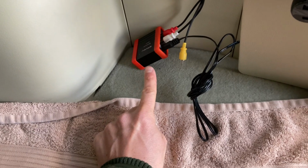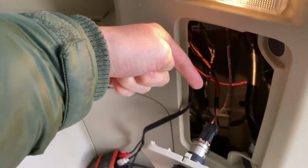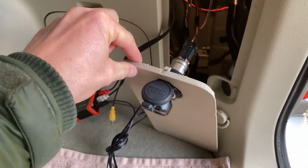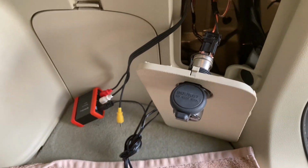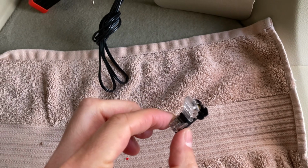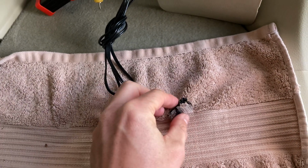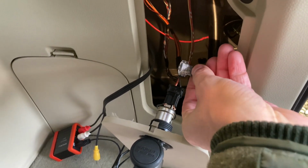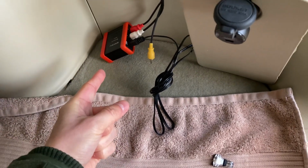All right, I'm back at the car now. As I was saying, I've got this Bluetooth module, and the cable that I plugged into the TV tuner behind that trim just drops nicely down the back here, and through this little piece of trim. I was talking about tapping some power off this cigarette lighter power lead, and I was going to use these T connectors. They're solderless connectors. In theory, you just clip it onto the power lead, and then off the side of that you plug in your device, which in this case is the Bluetooth module.